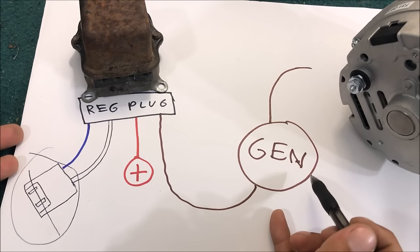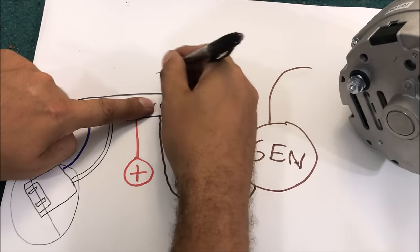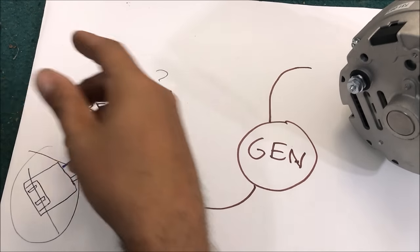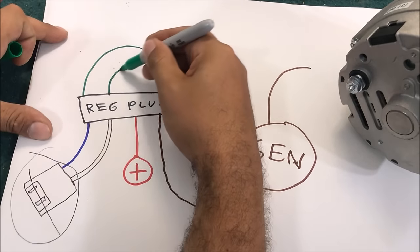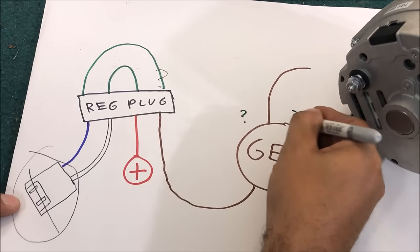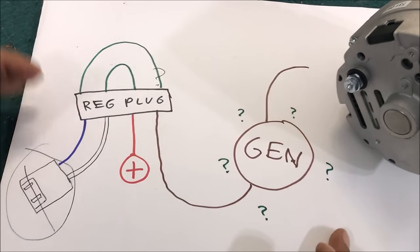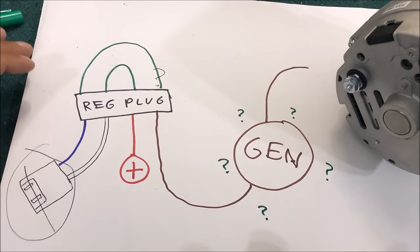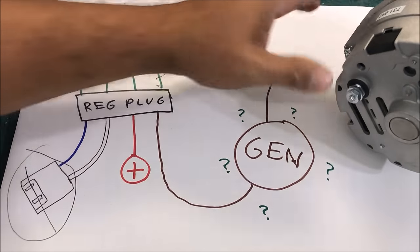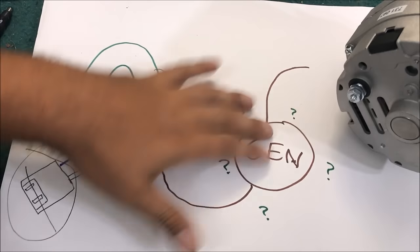With a one-wire we don't use the plug at all. If we still have the regulator in it, that wire usually goes to blue to excite it but now it's not hooked up to anything. If we unplug the regulator, the gen light doesn't go to anything. If we put in the two jumper wires as shown, and this still isn't plugged in, there's no way this light is coming on - it's not coming on.